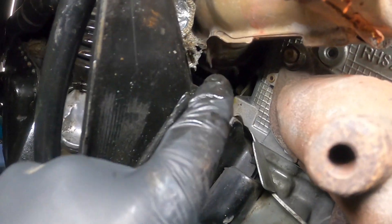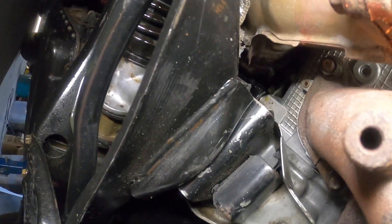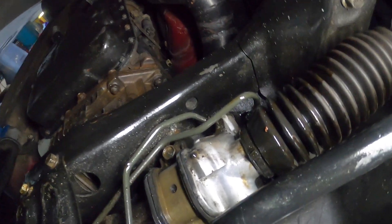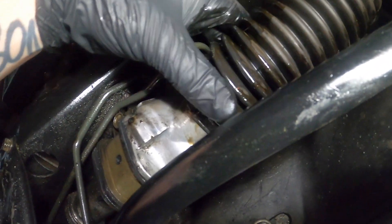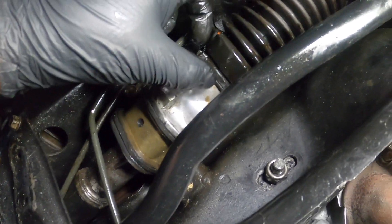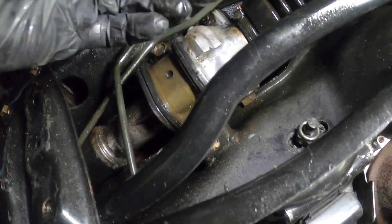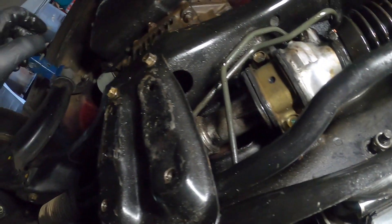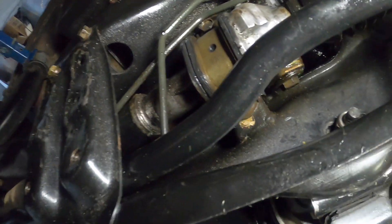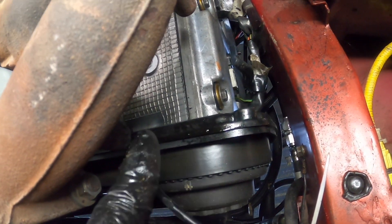That T piece for the oil drain looks a bit wet. Then I went down here to this boot - the boot looks wet, and I touched it and the whole thing moved, which it shouldn't. So that cable tie isn't tight enough - let's see if I can get another one on there. That's definitely oil. Also looks like my cam seals are leaking on both sides.